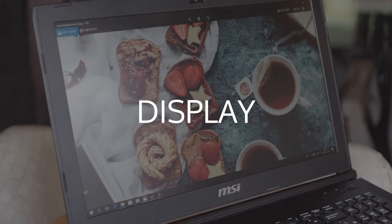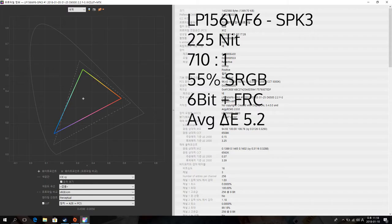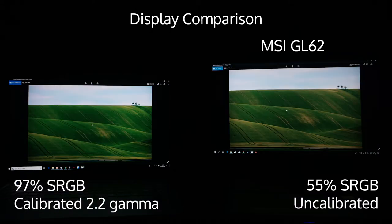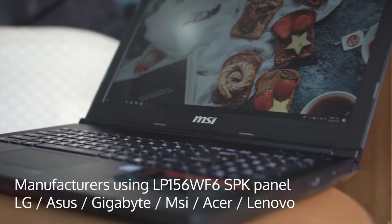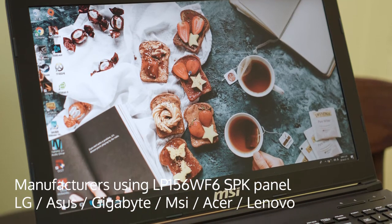The screen on this laptop is the poor quality matte IPS panel that almost every laptop at or under $1,000 seems to use. The brightness and contrast is mediocre, and the color space coverage is extremely limited at only 55% sRGB, heavily desaturating images. The viewing angles, while not exhibiting the extreme color shifting as in TN panels, are still quite poor for an IPS panel. The TN panel model uses a Chimei display, which has very good color gamut, but is reported to have poor contrast and low brightness, coupled with narrow top-down viewing angles. Since literally all of the competition uses the same panel lineup, you really cannot get a better display at this time if you are looking for a sub-$1,000 gaming experience.